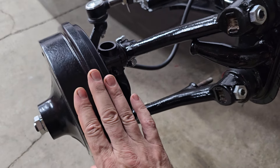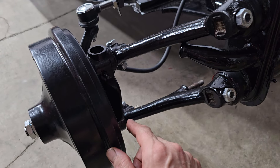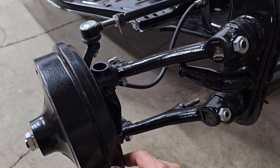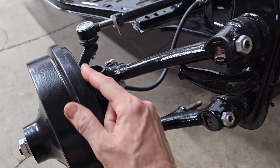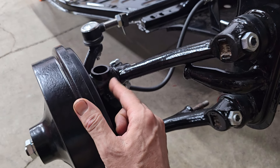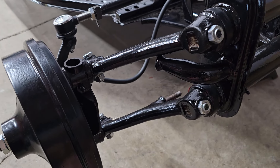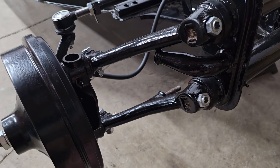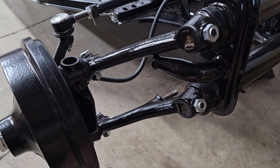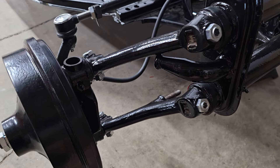This side had an offset of six millimeters and the shims were pretty much by the book — I was happy with them. The other side also measured six millimeters, but I wasn't happy with the shims, so I actually took an additional shim from the outside and put it on the inside to make up a little more distance. To me, the shim guide based on that dimension is just a starting point — I don't consider it gospel. That's why I always do a dry assembly and check things, and once I'm happy with whatever number of shims it ends up with, that's when I go ahead and grease everything.